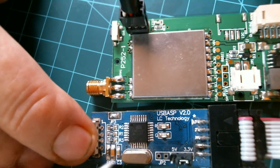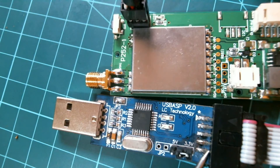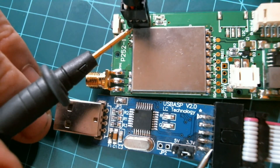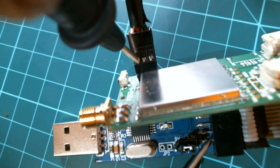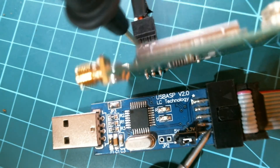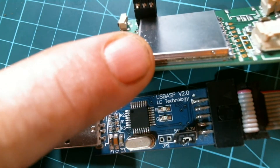Find a little bit of paranoia here — what we're going to do is just check on here. I know that pin nine, because of our drawings coming out of my USB ASP programmer, pin nine is going to be my MISO — M-I-S-O. And I know that on my plug that I just made up, pin one is on MISO. So pin one on my programmer is going to pin nine coming out of my USB programming card. So on my pin that I've made up, I've proved that I've got my cards the right way around. We could do even one more test just to double check with the voltage.